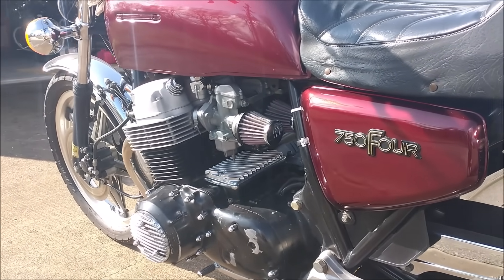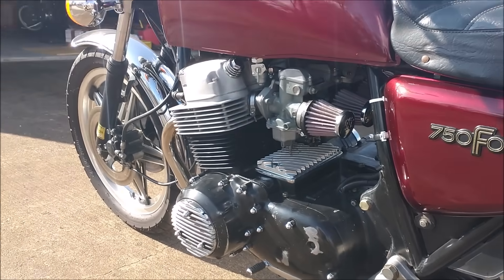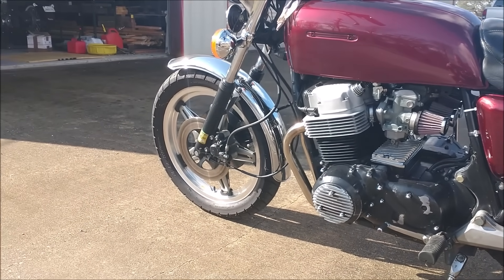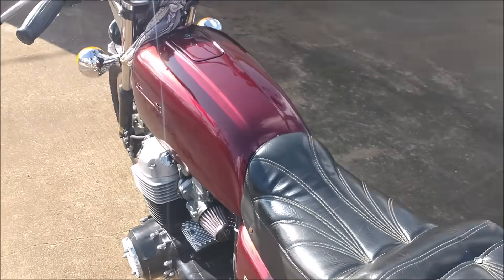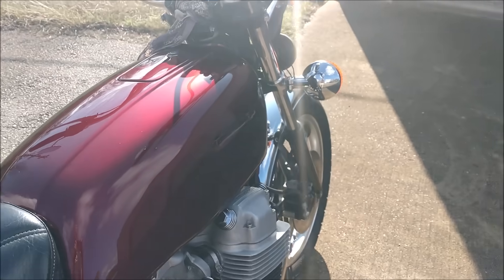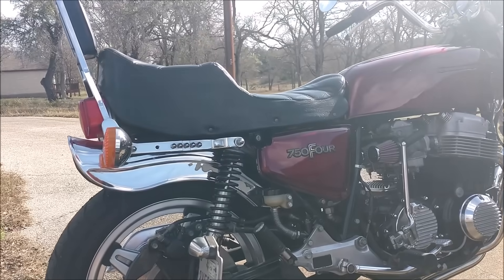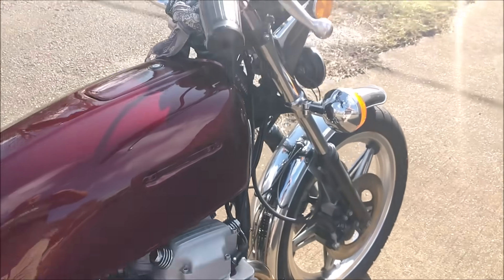A little bonus material for those of you that hung in this far — the bike is complete. I don't have the badge on the tank yet, but this is a Honda 750. The engine is bored out to 836cc. It's an F model, so it's got the hotter cam, bigger carbs, electronic ignition, K&N cone air filters, Delkevic four-into-one headers, Comstar wheels, and the tri-disc braking system. Candy red paint job — my son did that for me, and it's an absolutely spectacular paint job. The rear fender is a Fat Bob Harley fender with a king-queen seat by Corbin Gentry.